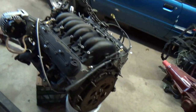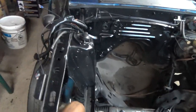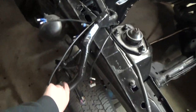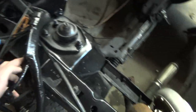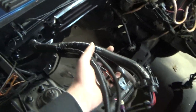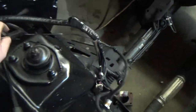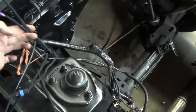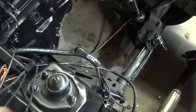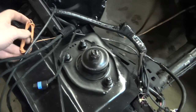So that's motor and transmission stuff. While it was out, I did some more cleaning up. The MSD and Megasquirt wiring was just kind of thrown in to get it to run, so I went back over everything and really cleaned up the harnesses so you don't see many wires. Here's the Megasquirt harness: throttle position sensor, fuel rail left banks one and two power and ECU feed, coolant temp sensor, and intake air temp still needs to be wired in.